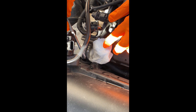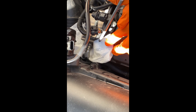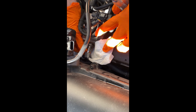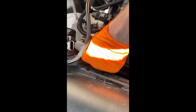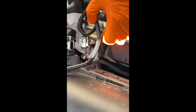Here, I pulled off the nut and this line is what we're going to remove. You can see that this is threaded and that the threads are part of this block. That's one of the ways you can tell the difference between the two high pressure fuel pumps I've seen online — on the N14 you screw into the block, but on this one the pump itself screws out.